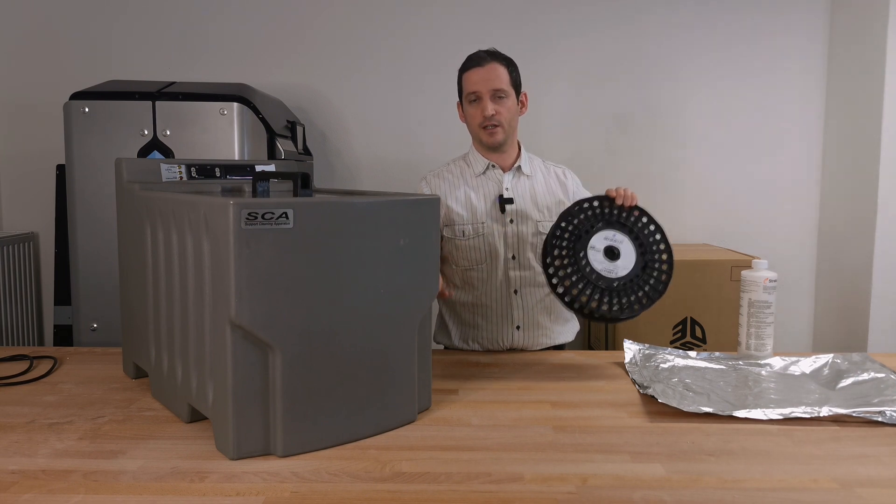I have put water into the tank and removed it from the box, so we don't have any thermal insulation right now, but you can see what's happening inside. I will just get in the waterworks soluble concentrate — this should be around one third of this bottle for 10 liters. I'm using my safety glasses and also my gloves. Let's put this thing onto circulation. You always have to put this into the tank when it is in a cold state, so just read the safety instructions.